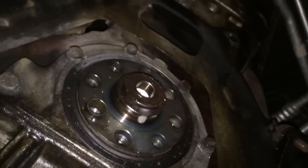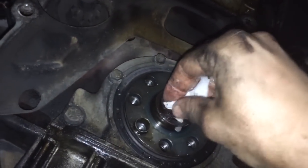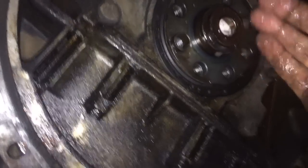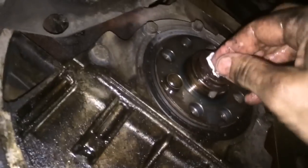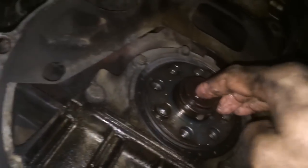I'm going to get another sheet of paper and come back to finish it up on the video. I think I've got enough paper now to finish it up. This doesn't actually have to soak very long — maybe only 15 seconds or so. Pack it until it's basically coming out of the end of the pilot bearing. This gives you the best amount of force to work with. This is basically just acting on water pressure, pushing the backside of the bearing out, and the paper acts as a binder so the water doesn't exit.